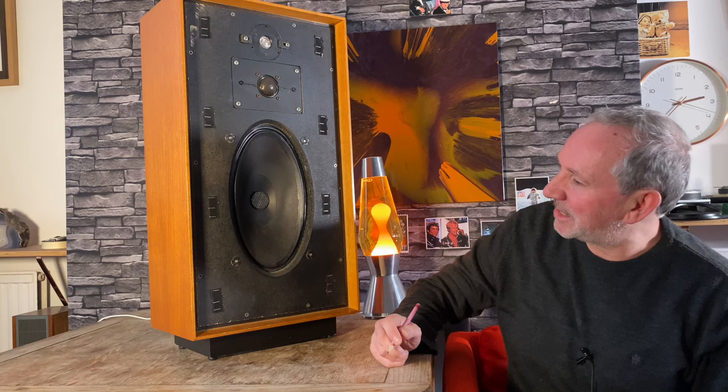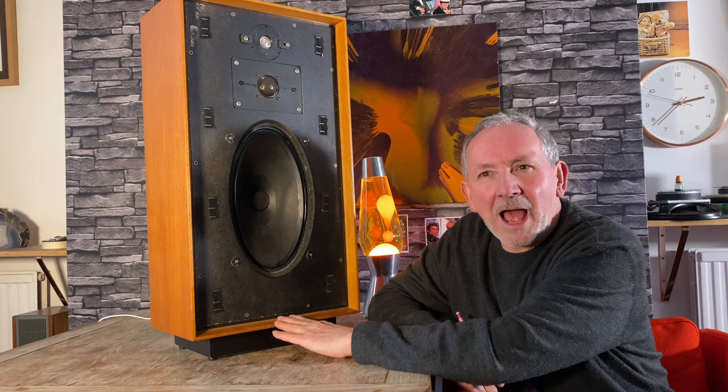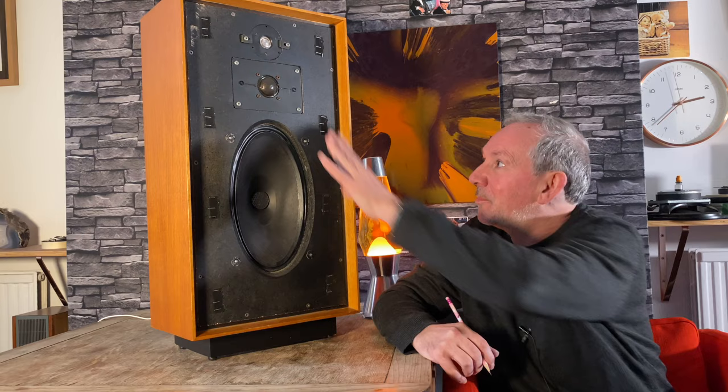One thing I'd definitely do with these speakers: I lifted the front up slightly — just a book under the front, about 15mm — because this driver sits very close to the floor and mid-range coming out the bottom was disappearing into the carpet. I'd do this with a lot of floor-standing speakers, particularly older ones like KEF Concertos. Angle it up and the tweeter fires up into the room, so even 5mm of tilt gets you more mid-range and treble reaching your ears.